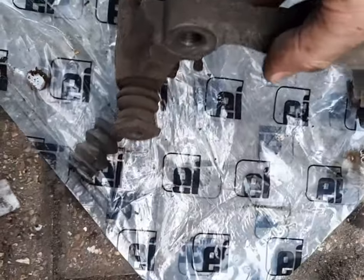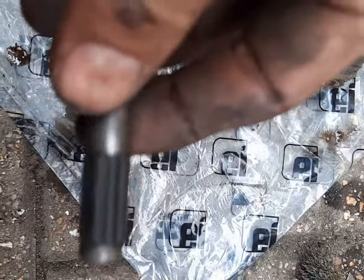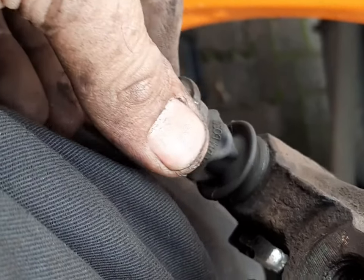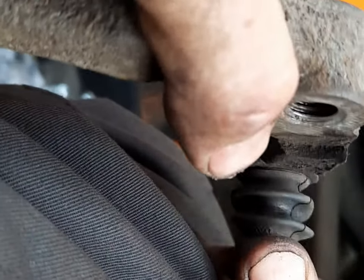Nice and tight. Now here's the carrier — we've pulled out these sliders. This is a rubber bit that's on the end of one of them. Make sure it's all nice and clean to slide back on there with a little bit of grease. It is a bit of a nightmare to get back in there, but we managed to do it. This is what you should be left with — it slides in and out nice and easy. That's what you need to do. Plenty of grease, a lot of oil, so it moves smoothly. Here's the other side, just like that.